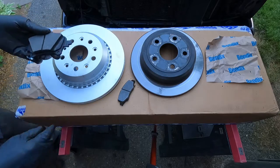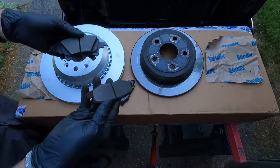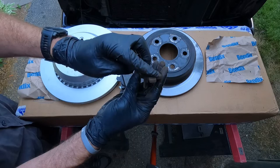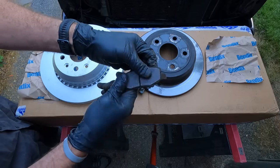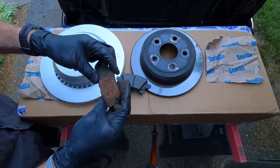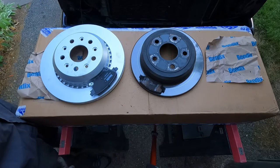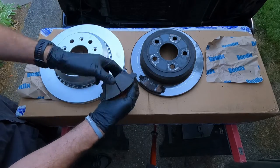Look at the brake pads — JT versus JK. I also want to show you this: I was going to have a problem in the future anyway. It's thicker on one end and worn down to the mounting surface on the other, so the caliper was hanging up or the piston was stuck. When I got it inspected they said it was time for new rear brakes anyway — and they weren't kidding. There's no contest here folks — big brake rotor, lots more brake pad material.